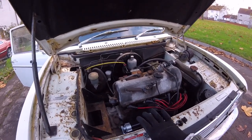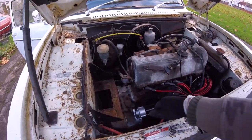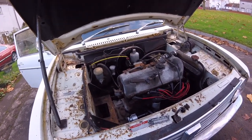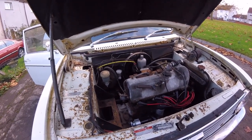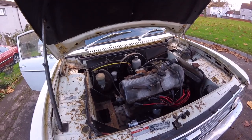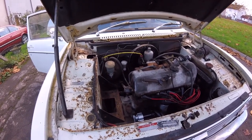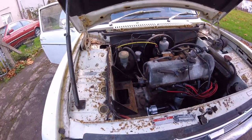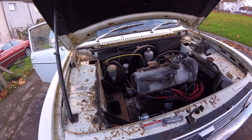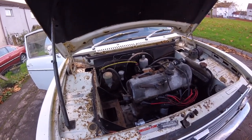When I went to try and get the car going, she said she and her boyfriend had tried to get it going but the starter motor was clicking. So I took a brand new fully charged battery with me just in case, because they'd been jump-starting it — which is not great if a car hasn't been used for a long time. I put my battery on and it just went click click click — they'd literally killed the starter motor. I tapped it on top with a hammer and she started turning over, but very slowly. I took the spark plugs out, checked we had all sparks, and sprayed some WD-40 down the bores to lubricate the pistons.